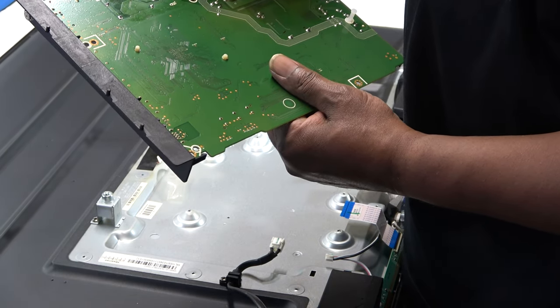This is negative, okay? Now, some capacitors may fool you and have this shaded side with a bunch of plus signs in it. That's positive. But in most cases, the striped side is the negative side, okay? And it also shows on the board, all right? If you're kind of leery, just look at another capacitor on the board, and you will see actually the negative is going to where this little shaded square is.